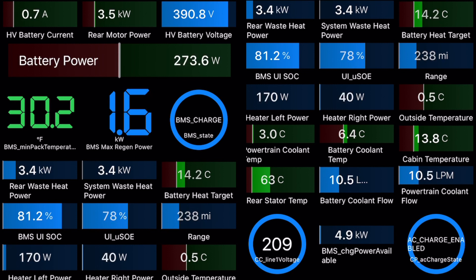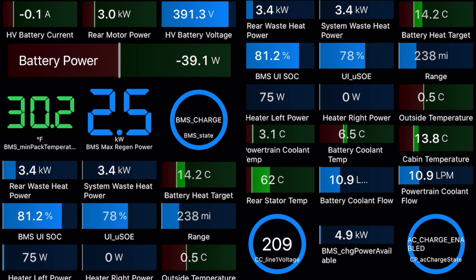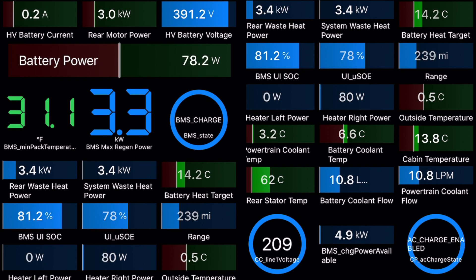We're just below freezing so it'll take a bit longer before actual charge power applies to the battery. You might also notice our indicated state of charge has gone up to 78% when it was 74% originally — it's compensated for the fact the battery is now a bit warmer, despite the fact that we have still not yet added any actual charging power. It's gained that percentage — temperature-compensated state of charge — just by heating the battery a few degrees. It has to wait for the worst-case battery cell to get above freezing, otherwise you could cause dendrites and battery degradation, or even a fire in a bad case.